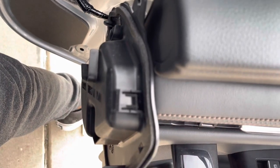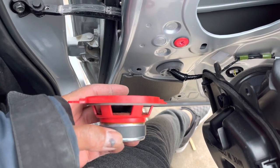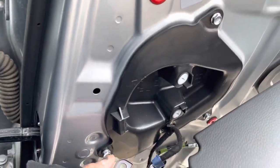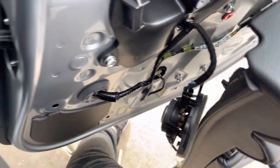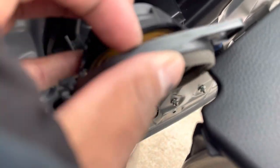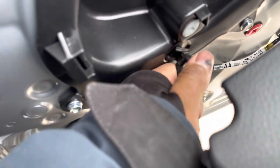Now that we figured out we can go deeper in the rear, I'm going to pull this tab out because you won't be able to mount the other speaker the same way — the tab doesn't face the same direction on this one. It faces down on this door, this one faces out. So the speaker sits in there with the tab out, but on the new one the tab faces down. I'm going to have to pop this little rivet out over here. That's out.